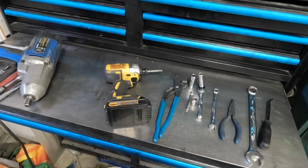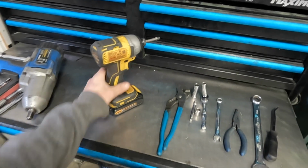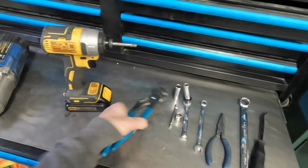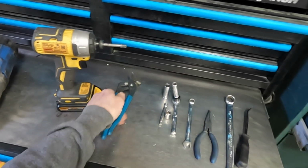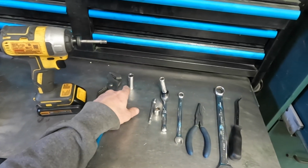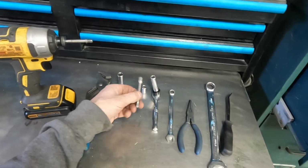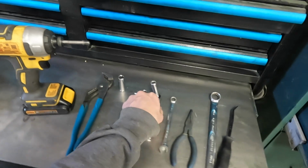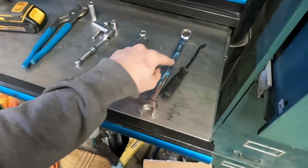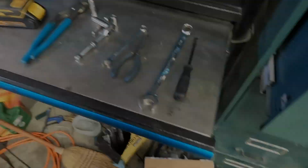For changing the valve cover gasket, I used mostly my 20-volt DeWalt impact driver with a 1/4-inch drive and 1/4-inch sockets. I used my channel lock pliers, a 12mm deep socket, although I don't think it needed to be deep, a 10mm deep socket, a 10mm shallow, a 1/4-inch extension, a 1/4-inch ratchet, 10mm wrench, needle nose pliers, 19mm wrench, and a little pry bar.